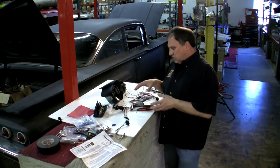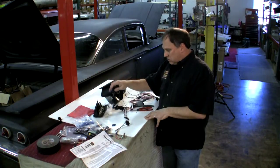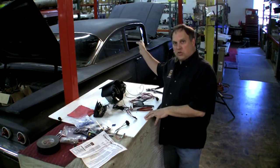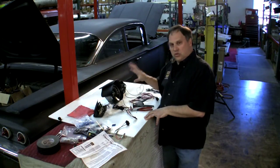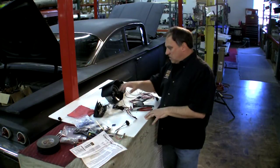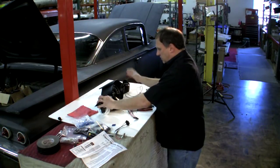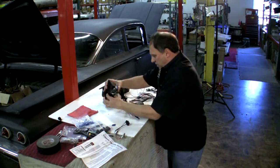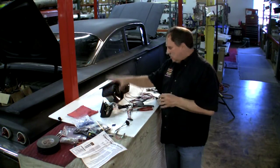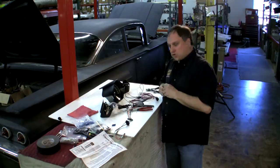Each of these gauges is going to be lighted and our speedometer cluster is going to be lighted, so we're going to need more than one feed. If you recall, we had four individual cluster connections in the car. This car is unique — normally we have one or two cluster disconnects where we just snap them together. But this particular car has a left-hand cluster, a right-hand cluster, and a center cluster. That necessitated us designing a system where you could build just the left-hand cluster, just the right-hand, and just the center, so you can put it all in the car and just reach up underneath and snap your disconnects together.